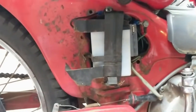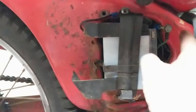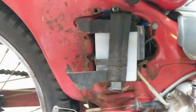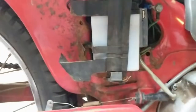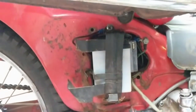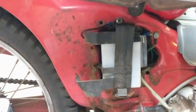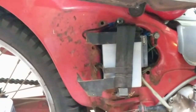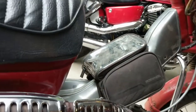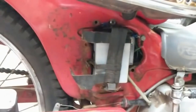Here it is all put back together with those wires tidied up. That battery case just fits in there really nicely. Just to repeat: the ground is connected there, and the red wire is spliced into the red that is already there using that little jumper I created. It will mean I have to pull the side cover off to attach a USB device, but that's fine — it's a once-in-a-while thing when I'm going on a ride and putting on my phone mount. I'll just run the short USB cable between those two. Hope you enjoy that, bye.